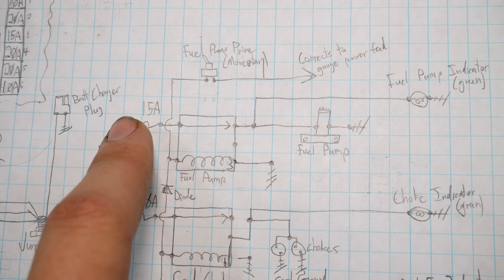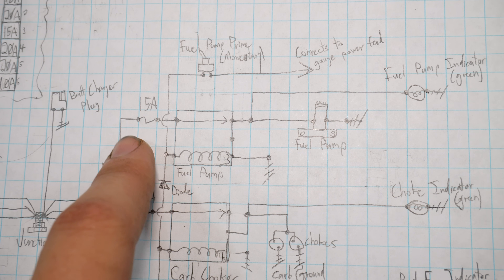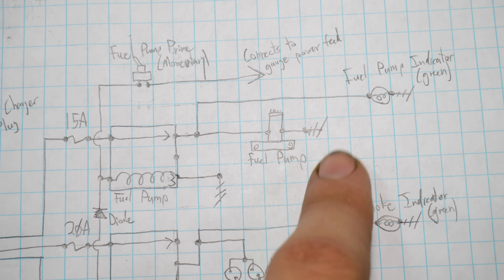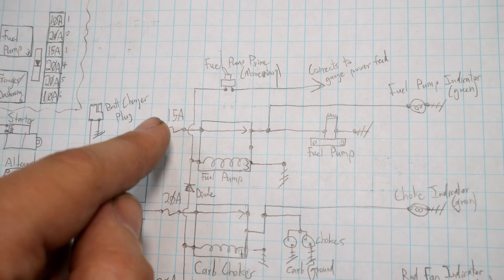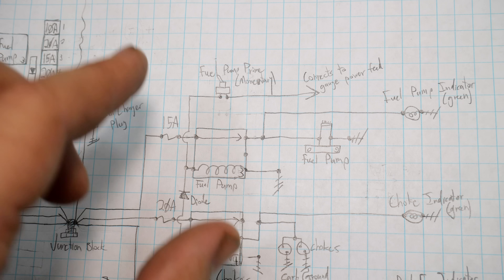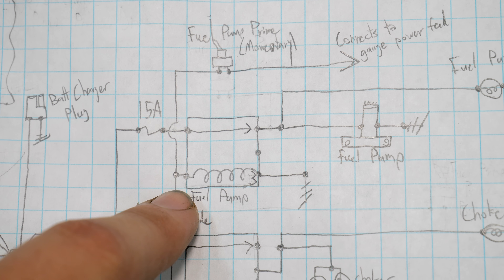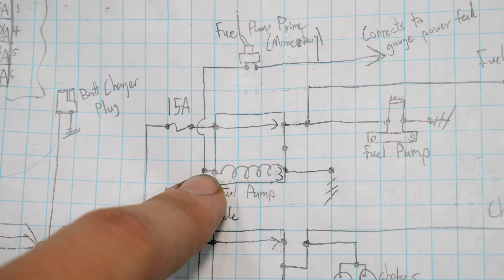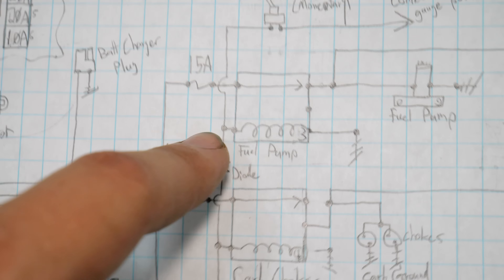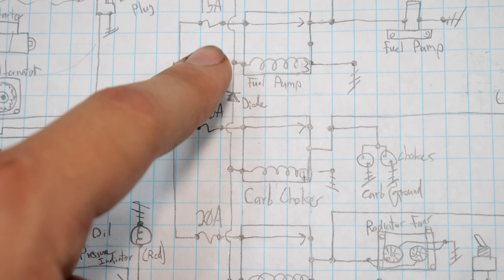If we're going with what's a pretty typical fuel pump wiring situation, the fuel pump is controlled on the positive side and just grounded nearby. We could completely bypass and jump over the relay with a switch, but then we're running two big wires into the car. So why don't we just have a switch to control the fuel pump relay? Well, if we just feed power in where it would normally be getting it, we're also going to be running the carb choke and radiator fan relay. So what do we do about that?